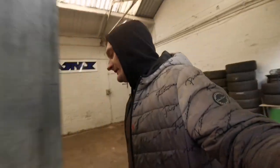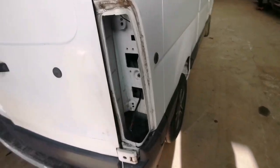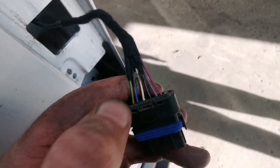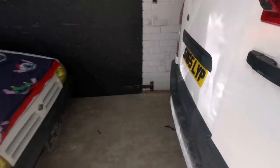As you noticed in the video, I was messing about with lights and couldn't get the reverse signal on. The thing is, when I got the van I never noticed that the reverse lights never worked from the beginning. After digging about, we found a little sensor in the gearbox that wasn't working. We replaced that, so now we have reverse lights coming on. The trigger for the reverse light is already live, so you just pick one of these - the black wire next to white is your ground, and that purple-red one is your positive feed for the reverse light.